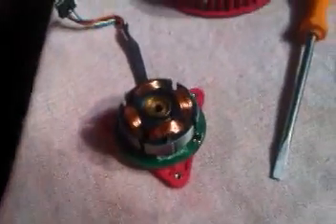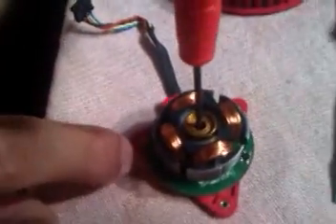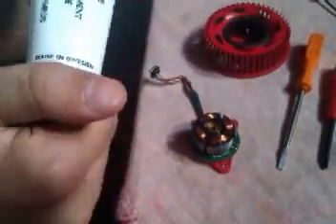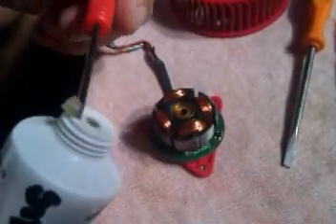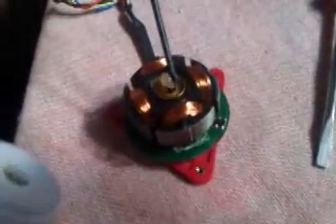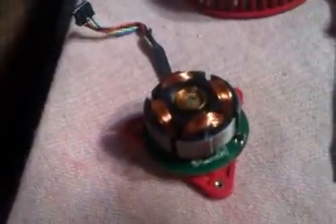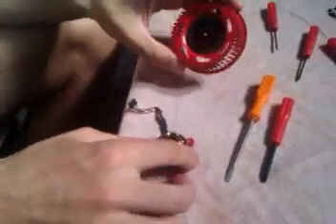The way to lube this fan is to put whatever lubricant you want into this hole. I use bearing grease — just put some on your screwdriver and put it in. You can use oil, whatever. There are forums about these things. Don't use WD-40 — as I've heard it doesn't do any good, it's a non-permanent solution.